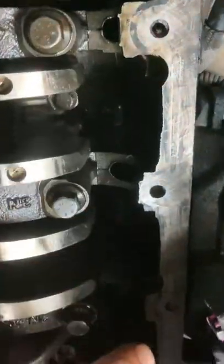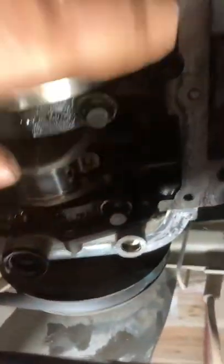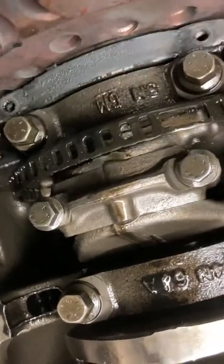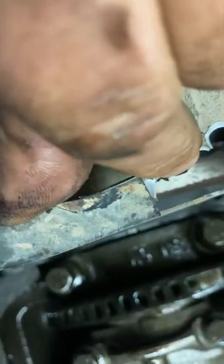You then take out your series of bolts around here. There's two small ones at the front and two big ones here, and then there's the two nasty ones which are here — this one and this one. You need to cut some holes in the gearbox. The straight answer is, with this, you need to be as close to the front as you can, because stuff starts to get nasty in here if you don't come close to the sump side. Do this at your own risk, but you can literally drill out enough to get past those.